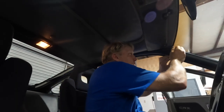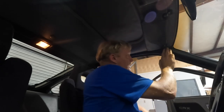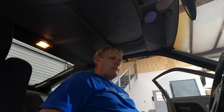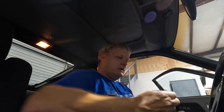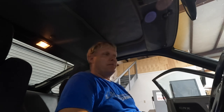And I said, hey, if you're interested in taking it for a drive, you know, meanwhile, I'm trying to sell Steve a job. So he goes, takes it for a drive. And he goes, ah, it's okay. I go, what do you think once you got it up in the RPM? He goes, well, I didn't run it hard. I only took it to like 5,000 RPMs. Well, a B16, they have no power on the bottom. They don't get going until 6,000. And he said, honestly, my car drives better. It's got more power, which was the D16 A6.